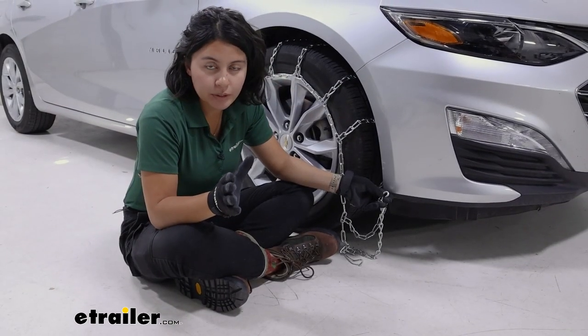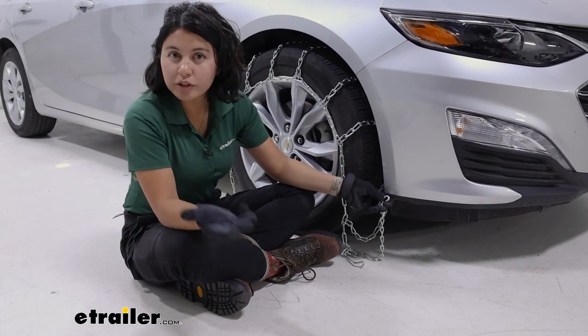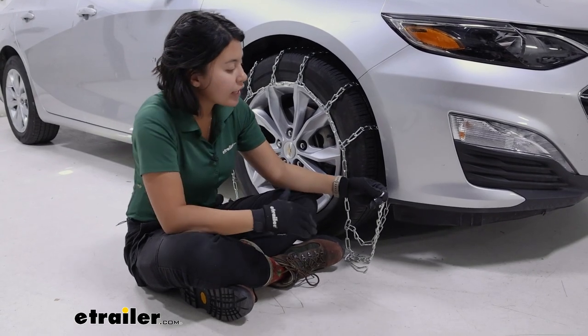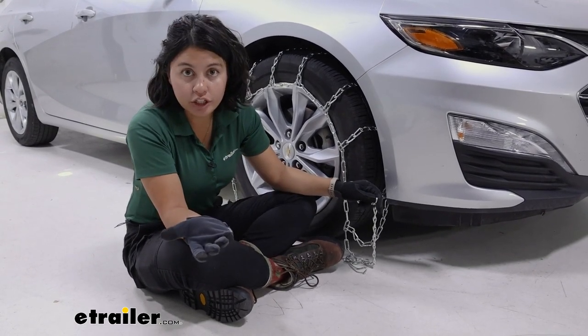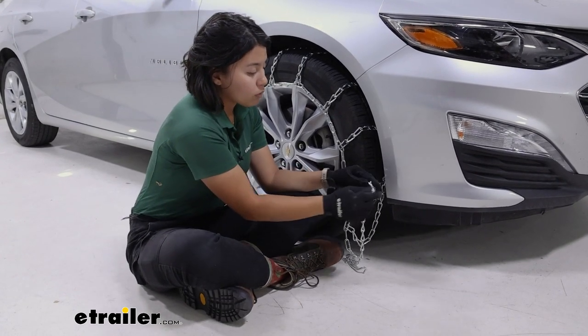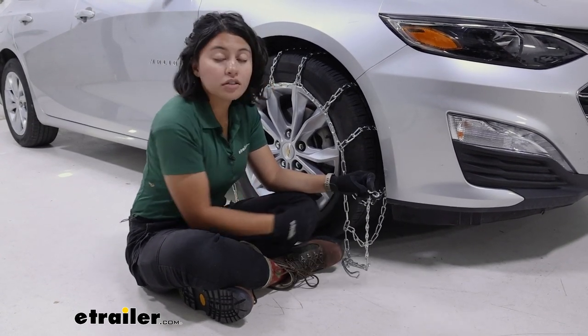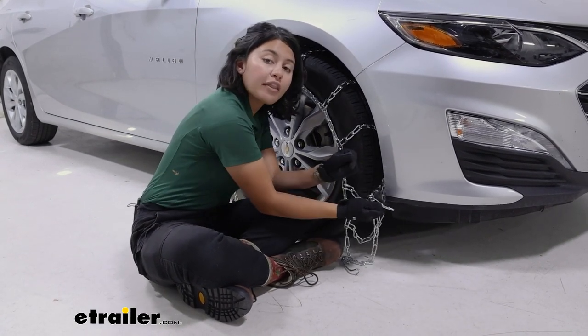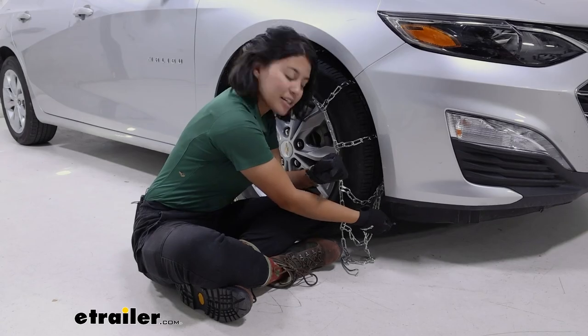There are different ways to install tire chains. The way I'm showing you is the best way to test fit in your garage, so you're not driving over things or maneuvering around. The side with the long hook is also the side that has the hook for the back connection, so make sure you're on that side to hook there.